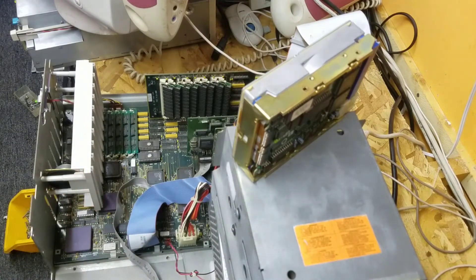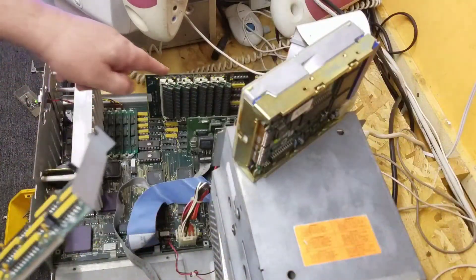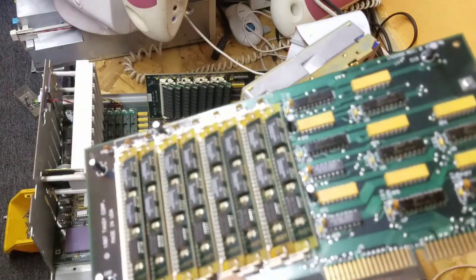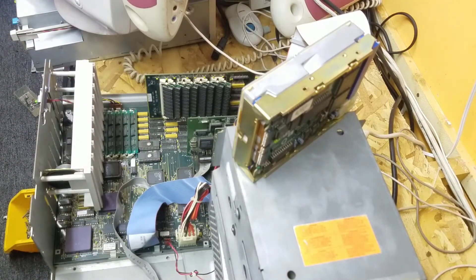Believe me, these parts were hard to acquire — they're all stock and original. It originally only came with a 1.44 floppy and a memory upgrade. It had a 4 meg card — here it is — and I went ahead and put the 9 meg card on it, which is the max I think this board can hold. This one is going to be going up for sale pretty soon on eBay. I don't need it, and this is only for the 4000. You could change these chips if you want to go more. I might even put RAM on it to take it up to a full 8 or 9 meg and test it, then list it. So look for that soon. I'm probably going to do a part two of this all closed up.